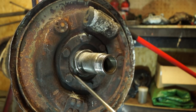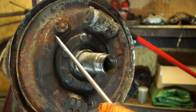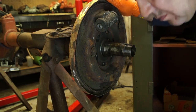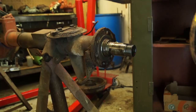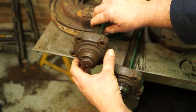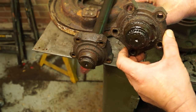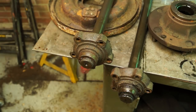If the backing plate is in good condition, just clean it up and check the adjusters are in good condition. You have a ring here which you remove first of all. The backing plate, if you're going to take them off, is stuck into place and you'll need a little tap to get that off. So the brakes are stripped down completely there. If you see these drive flanges they are worn, and possibly the half shafts as well — this one's leaking oil and it's worn. You can see how much play is in that; it would eventually lose drive on the back axle because it will rip the splines off the drive hub.